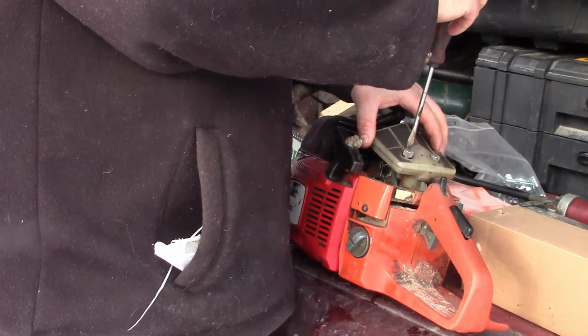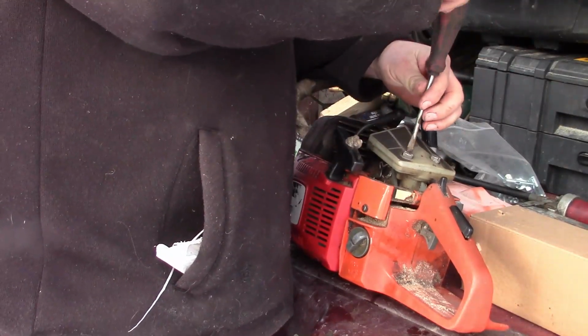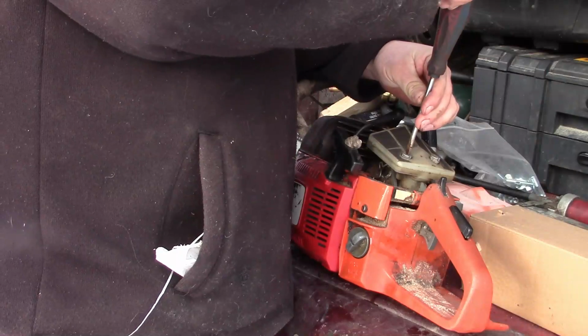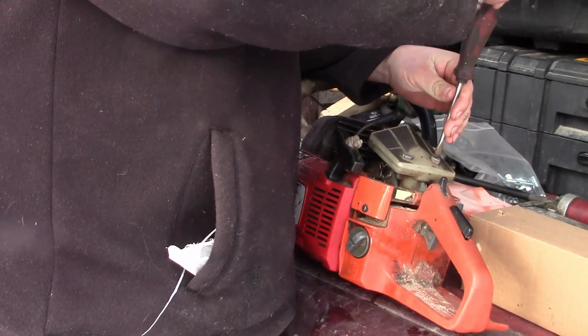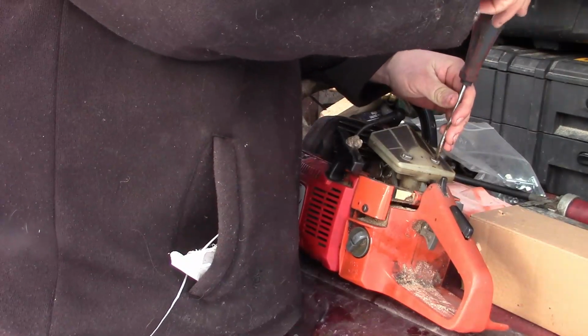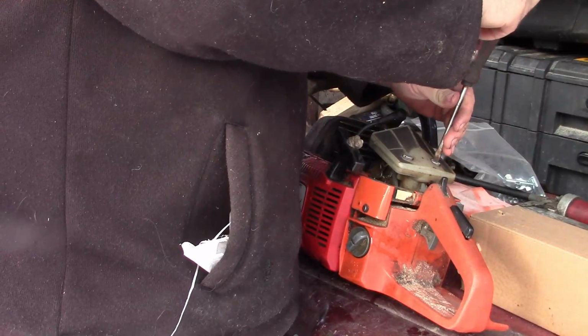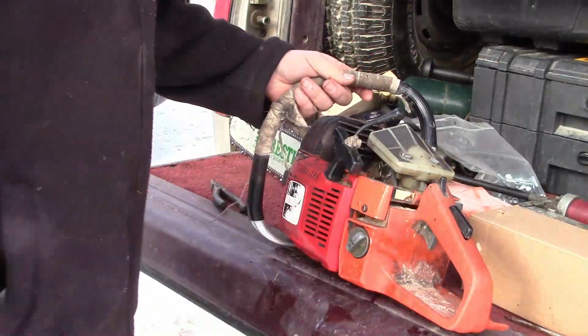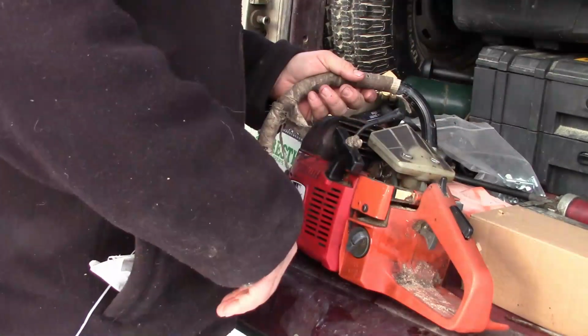But with the fuel line, you'll tune it and it'll run sort of okay for 2 seconds, and then it'll either fall on its face because now it's too rich because that gap in the fuel line closed up, or then you'll have it tuned perfect and it'll fall on its face because then the gap opened up and now it's too lean. So it's just kind of nonsense.